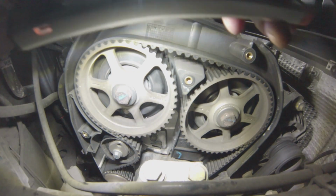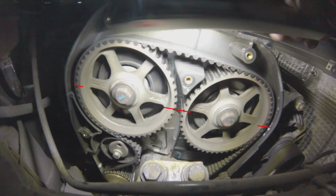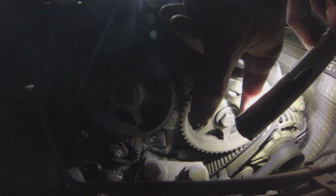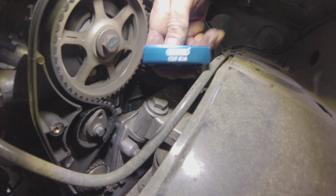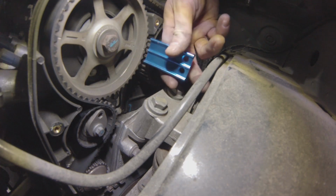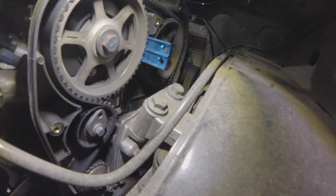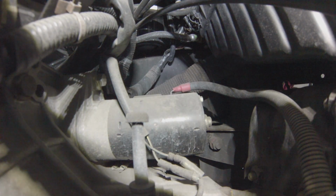So here's the end result. As you can see, the camshafts are perfectly aligned with the intake on the left and the exhaust on the right. And now's the time to grab this locking tool. This is not a sponsored video. I paid to get this tool, but there you have it. There's a reference number, and if you've stopped at the right place, then it should slide firmly. No sweat. So if you're not aligned, it just won't fit. So there you have it, piece of cake.